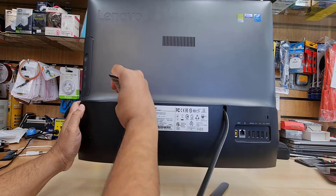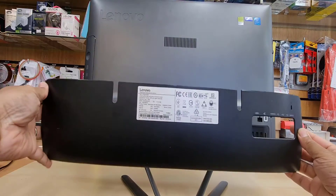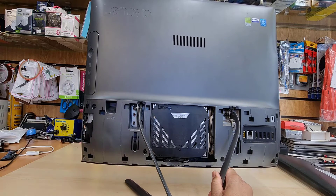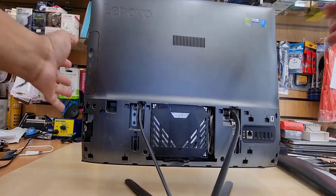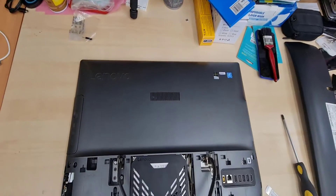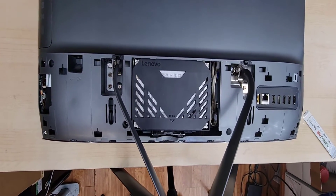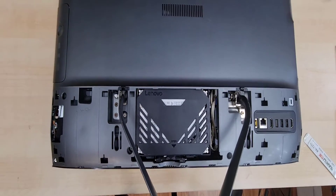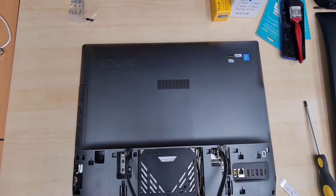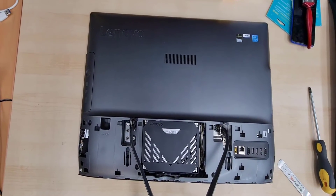There are two back holes, two knobs underneath — one on the left, another on the right. So it's going to come off like that. Once it's done, we're going to put it upside down on a flat surface. But remember, the front skin panel is very soft, so make sure nothing is underneath when you put it upside down. Then we'll remove the four screws from the stand and get access into the hard drive, which is a 3.5 inch SATA. Then we'll try to take out the back cover by removing the DVD drive front shelf. Let me show you one by one.